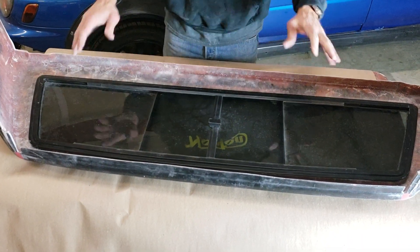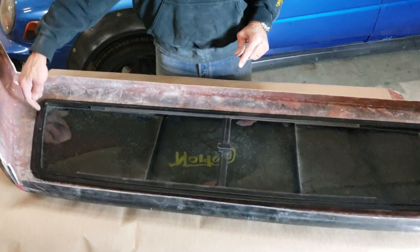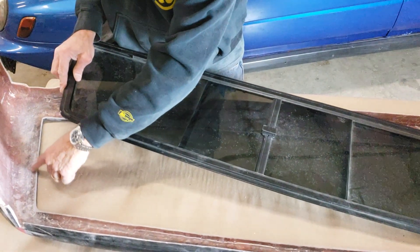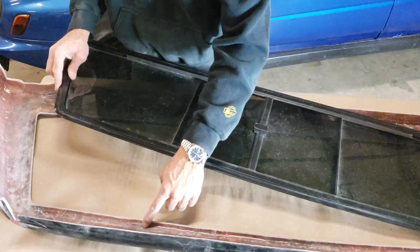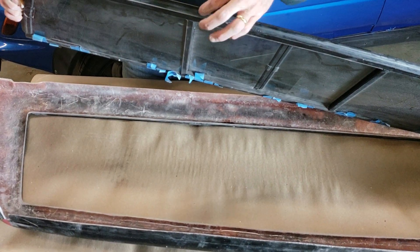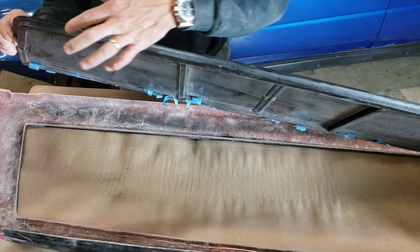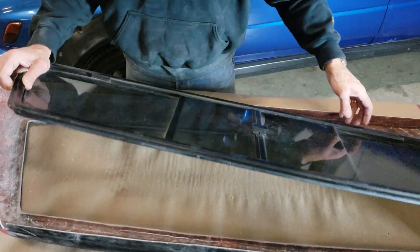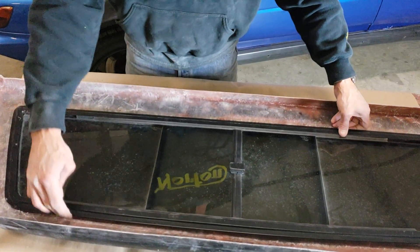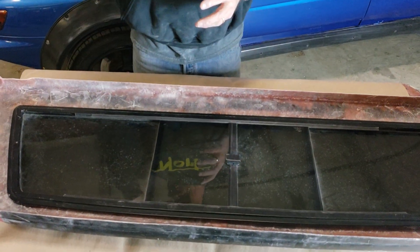So I have the rear surround flat on a table. I have my seam ground down to about 3/8 of an inch and we're going to be placing this window smooth side out into the opening. And this is the question I get. If this drops into the opening, that's fine — you can use windshield adhesive around the surface. I like to put about a half-inch bead of windshield adhesive right in here along the edge so that it sticks up a little. Put a little bit of windshield adhesive with your finger — with gloves on, of course — along here. Not so much that it oozes out when you put it in place. Then you set the window into the opening and the windshield adhesive bonds to the frame after sanding it. We have this in the manual and in another video.